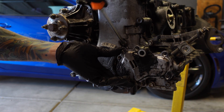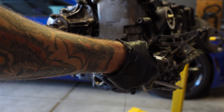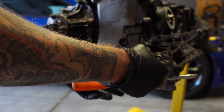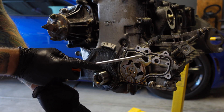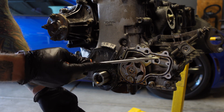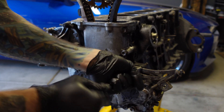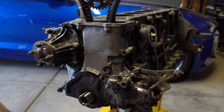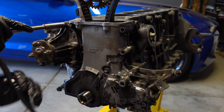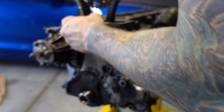The reason why I took this off now is because taking it off in the engine bay — or even once the timing cover is off the engine — is going to be really hard because there are those really tight Phillips head bolts, or actually JIS bolts. The reason why everyone strips them is because we're using American bits on Japanese screw heads. This is also a very popular gasket that goes bad on these motors that you can buy from Witts End. They sell a full kit to replace this O-ring right here.